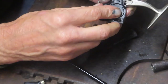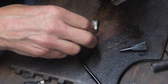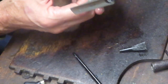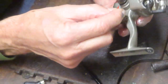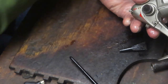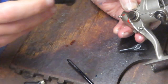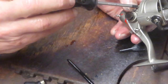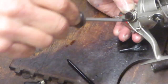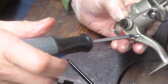Notice that on this bushing, we had a shim washer that goes on the main gear. Then we're going to bring the case over — nice snap of the case. The two long screws go on the side here and the short one goes up top on the corner. If you didn't notice that, you'd go back to your pictures to verify. Manufacturers do that sometimes for space constraints or to avoid interfering with an internal part.